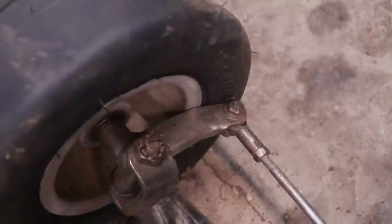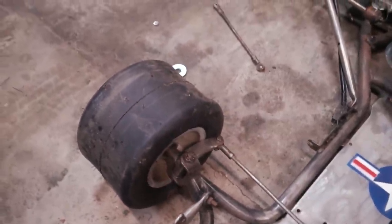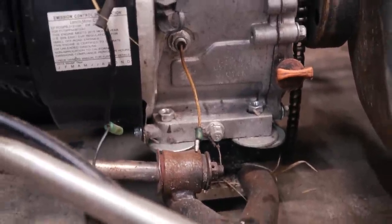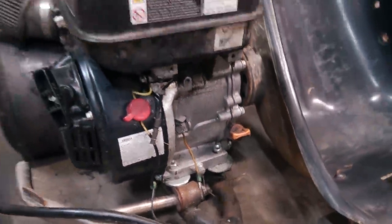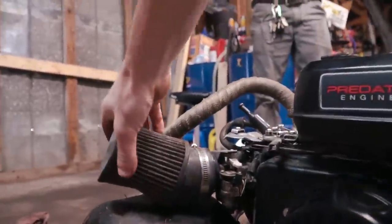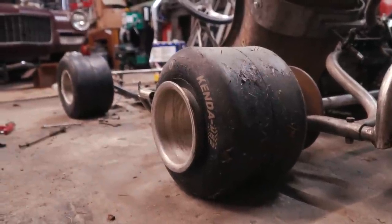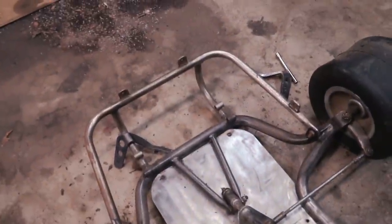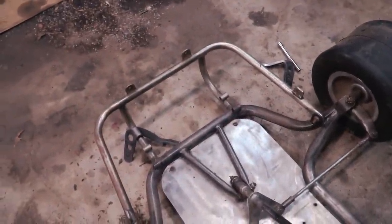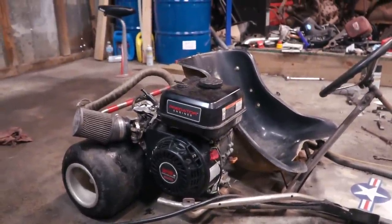Here's a complete list. Gotta trim the steering piece that comes off the spindle, and we can't space out the wheel anymore. General weirdness with stacking washers on the engine. If you look, we have about 2.5 threads on each of those nuts. The air filter, we cannot ride it with air filter on it because it's sitting on the tire. That tire never properly seated. It still has air in it from 3 years ago. Throttle cable, brake cable, throttle pedal, brake pedal. Brake linkage. Definitely got to put new fuel in it. Wouldn't hurt to change the oil as well.